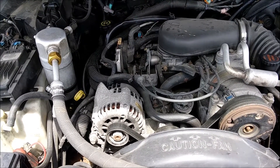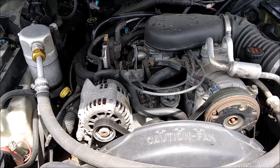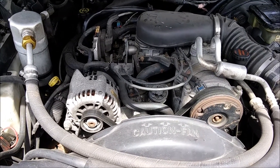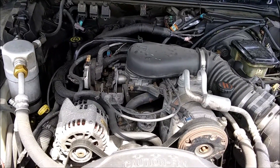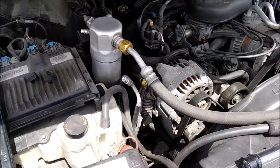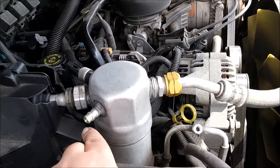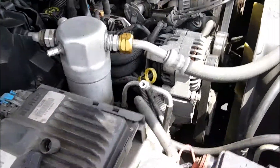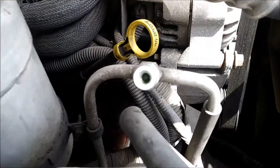I'm going to discuss about $20 worth of other repairs you can do at the same time that will likely eliminate your problems for good — an actual repair instead of just a band-aid. In my experience as a hobbyist doing dozens of cars, there are three main places where you'll have a refrigerant leak on an automotive AC system. Two of those places account for maybe 90% of failures: the pressure ports. This is my '97 Blazer, and it has two different styles of pressure port.